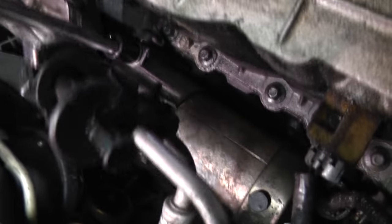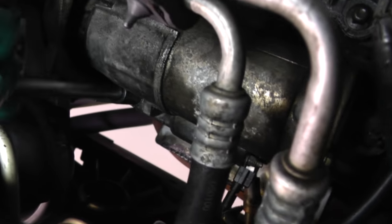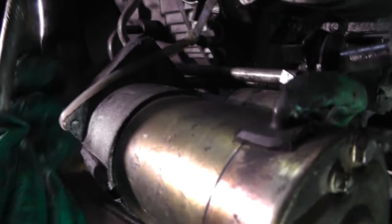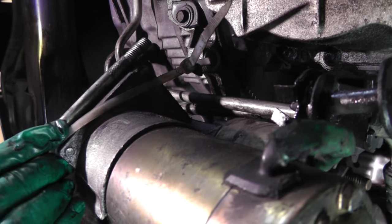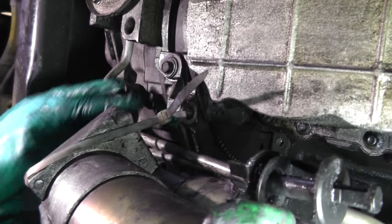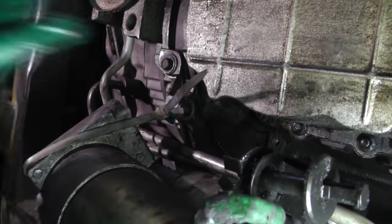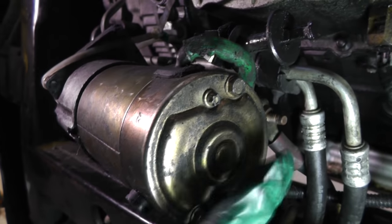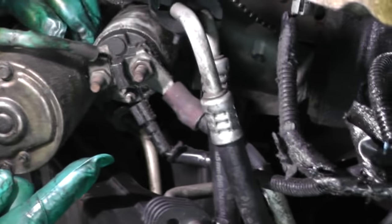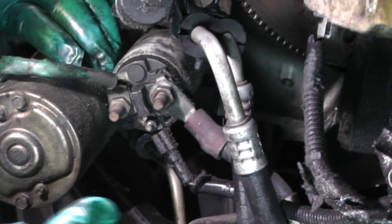So this is what I'm going to be working on — this bolt and that bolt up there. I'm going to be taking these bolts out. The longest bolt is the one that goes up through here — this is the one that was partially covered by the cover. The shorter bolt goes up on the other side. I've got it maneuvered down with a tie wrap to anchor it up where the plastic fastener was. By the way, those mounting bolts take a 15 millimeter socket.